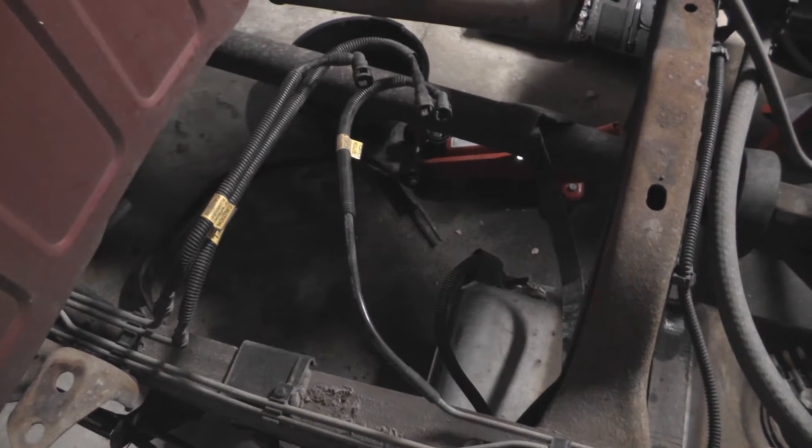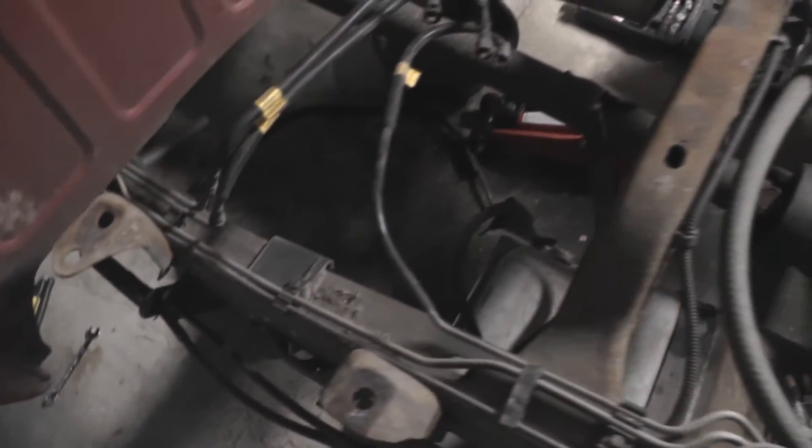I finally got the fuel tank out of this thing. It took a lot longer than I thought it would, mostly because of this one bolt. I don't know if you can even see right in there — it's a little dark. There's one bolt in there that's blocked by this line right over here, so you can't really get a ratchet on it or an impact or anything. But it has to be almost completely out in order to get the fuel tank out.